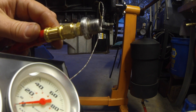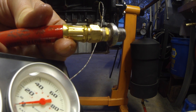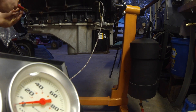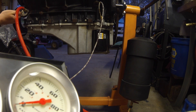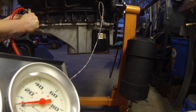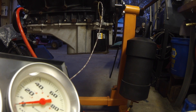As you can see, I have the same plug on the end of my hose, just drilled out and tapped for the air fitting. Let's thread it into the block. One thing that probably would have helped is having some type of spinning swivel so it doesn't turn the whole hose. I cut two flat sides so I can grab it with a crescent wrench. Normally it's round on the outside, but I cut a flat side on each side so the crescent wrench fits around it. Snug it down — not too tight, just good and snug so it's not leaking.